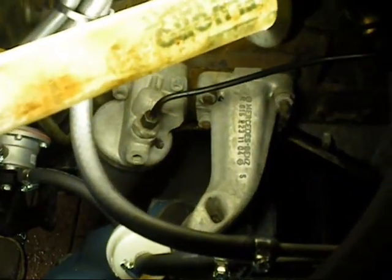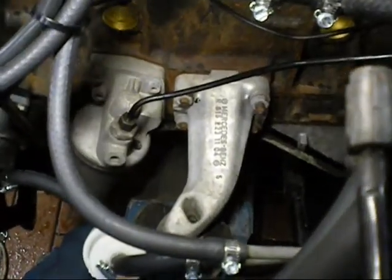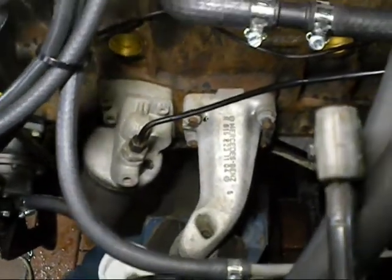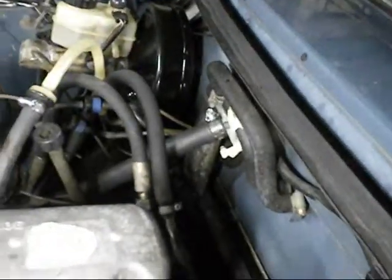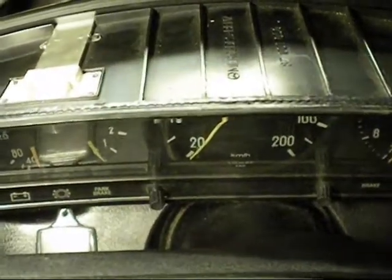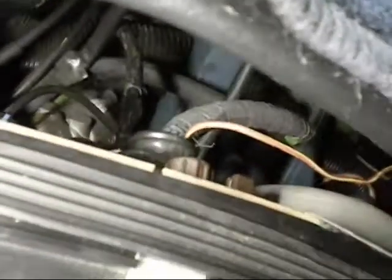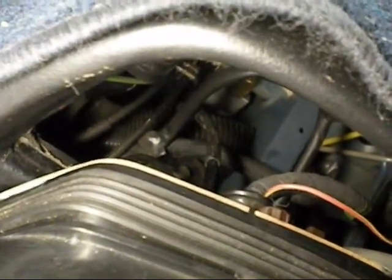I managed to get my hands on a good second-hand oil gauge pipe, but it's not quite right for the car — it's a bit shorter than the other one, but it's got the right fittings on it. It'll run a different path, but it goes in. This is where the little oil pipe ends up for that gauge there — you can see it just there, the one with the nut on it. You don't want it breaking in the cabin and pumping all the engine oil in here. I'll just tighten that up and put the dash and instrument cluster back in.